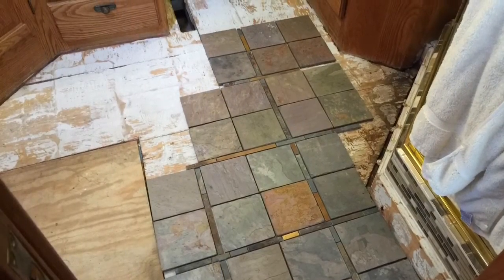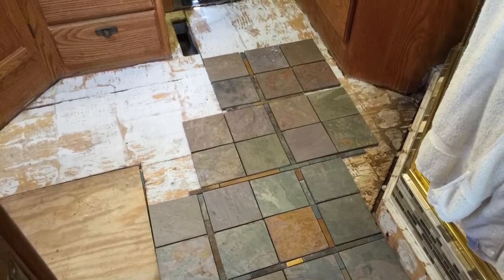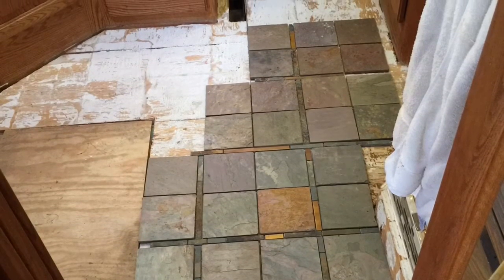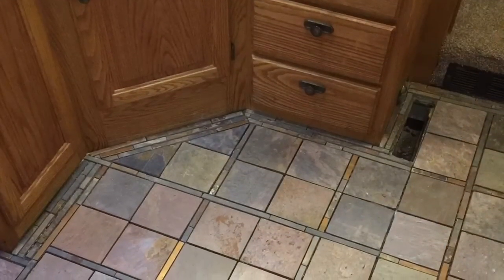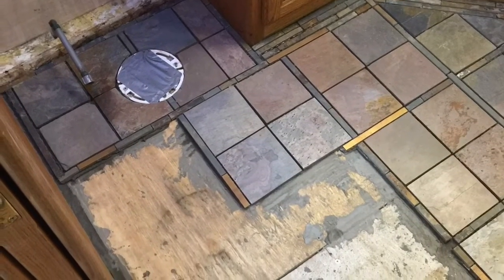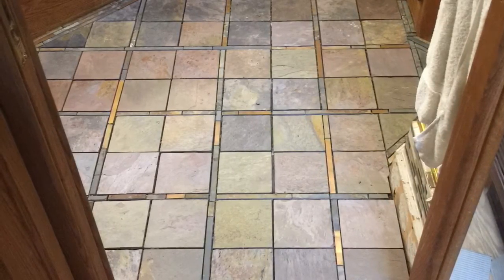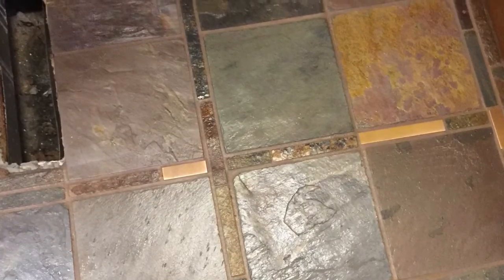Since this is a tile job in a vehicle, I wanted to make sure the tiles were very well stuck down. I did my initial layout work and carefully buttered both the underlayment and the bottom of each tile to ensure a very good bond. There are accent strips in between, and I did the same with those — they are not nearly the same thickness as the slate tile, so I had to build them up considerably. I have a background in bricklaying, so it was similar to laying bricks. I spent about three to four hours getting the tiles down, and it really paid off.